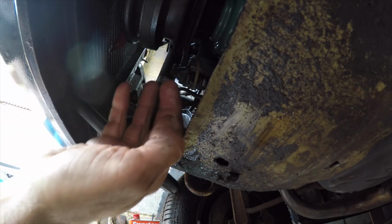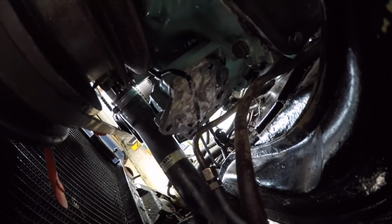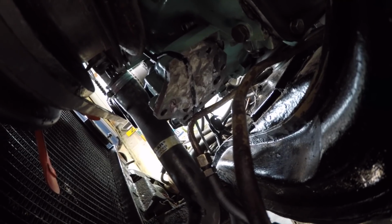Cool, right, I think I'm going to cable tie that in place because that's not going to hold on the rubber band. Well, I don't know if you can see this or not at all, but the two gears are now held in place with a cable tie, which I can then snip off and remove once I've got the bolt or two in place. Pack as best I can with Vaseline, which is how you prime a Rover V8 oil pump.